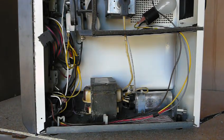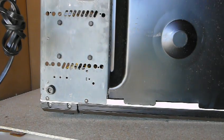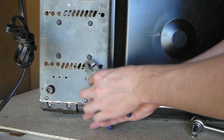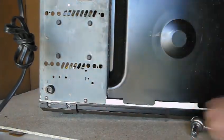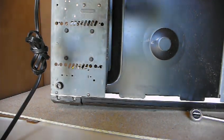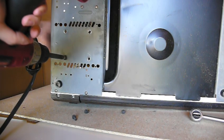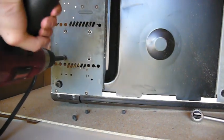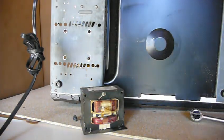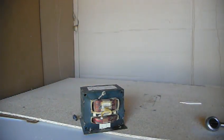Once you're all done, flip it over. Usually it'll be attached with four bolts at the bottom, sometimes they're Phillips screws, sometimes there's a mounting bracket — just figure it out. If you don't own a ratchet, you can use a pair of pliers, but it's much easier to use a ratchet, and even easier than a ratchet is a drill. For the last bolt, remember there'll be nothing else holding it, so hold it with your hand — it's quite heavy. And there you go, the transformer's out. You might also want to pull the power cord, the fan, and a few switches from the microwave carcass.